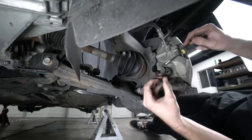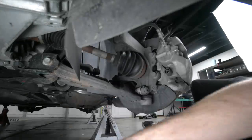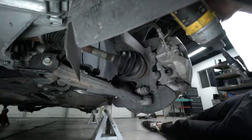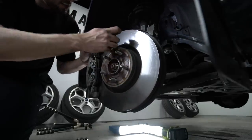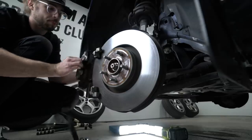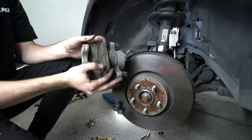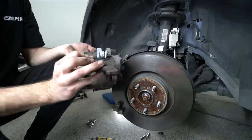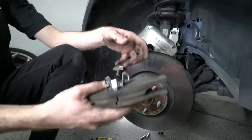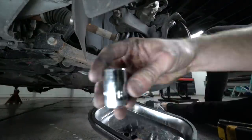We've got two plastic clips covering two bolts, and those two bolts are T45 Torx. You're going to see me zap them out — there's the bolt, it's a long-looking weird bolt. Now the spring that holds the calipers together — you're going to see how I pry it off. It's super hard to get off, just stick it in there the way I did and it should come right off. Now I'm going to look at the orientation of the pad so I don't forget when I put the new ones on. I'm going to pull the inner brake pad out — it's like a spring thing that goes in the piston. You can see my stock OEM brakes are in great condition. I think someone recently changed them or this car wasn't driven very hard.